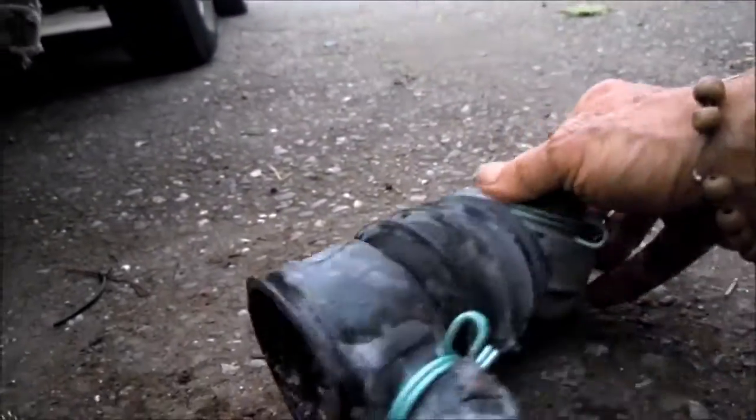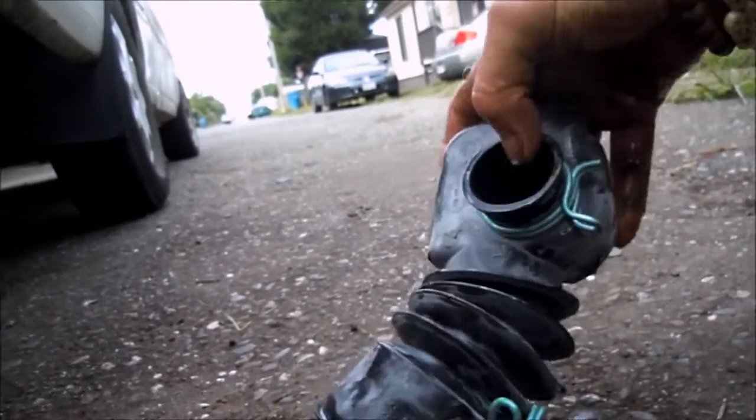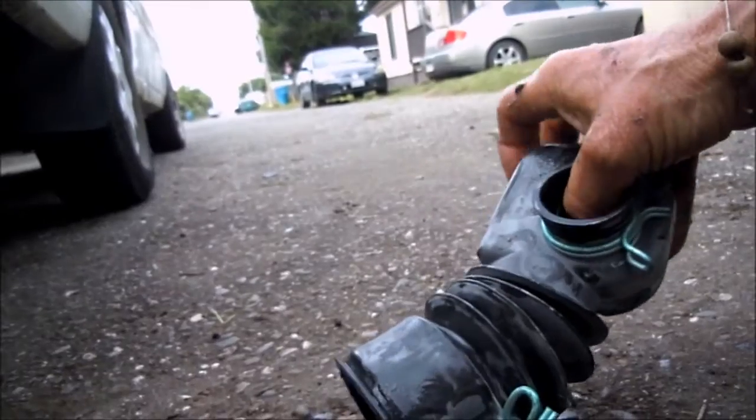You can feel in here and feel the bottom of the tub, feel around in there for any debris. This is pretty well plugged up — this is probably going to be the problem, the reason why they got rid of this machine. Basically there's like a filter in here that needs to come out so we can clean the filter out and clean the whole thing out.